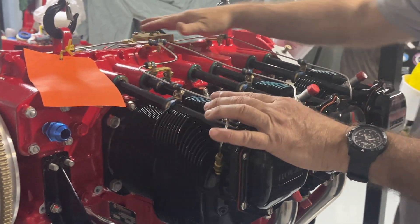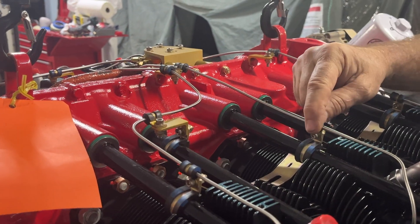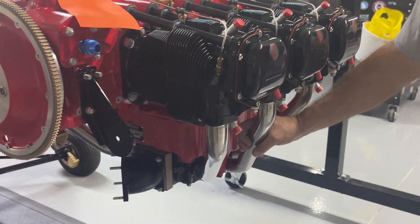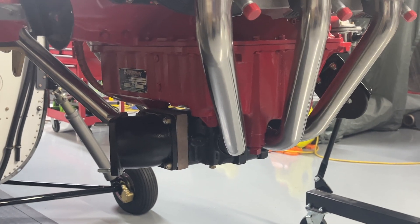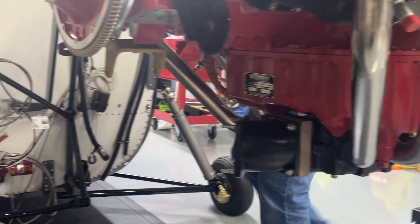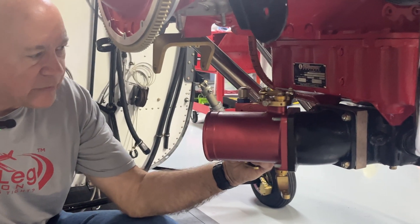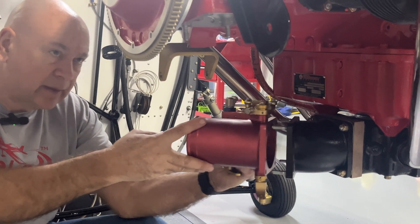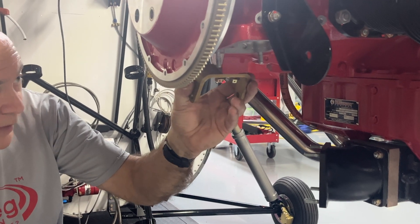You can see it's an injected engine. The ADs are taken care of — meaning every six inches minimum, all the injector lines are properly secured to the engine so they don't vibrate and break. This is a cold air induction system. It's going to have a real nice setup — this is from Airflow Performance. I love their setups. This will go on right here, all set to go once we get this thing in the engine mount, and then we'll run a tube up here to an air intake. The alternator is here; we're going to put a B&C on this and put that on after we get it mounted.